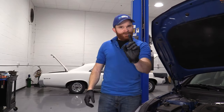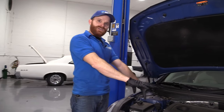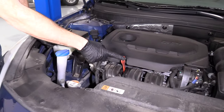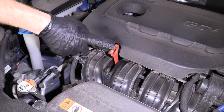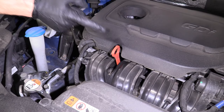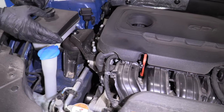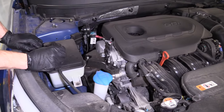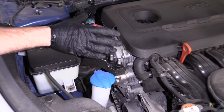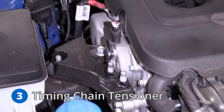Now that we're under the hood, we need to think about one thing: are you up to maintenance? Specifically, have you done your oil change recently? If your oil is dirty or low, you're definitely going to want to service that, because if your engine is either of those, you're obviously going to have some noise. But if you are up to date on your maintenance and the oil is perfect as it should be, you're going to have an issue inside of the engine on the passenger side — and that's going to be a timing chain tensioner.